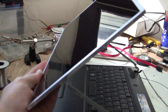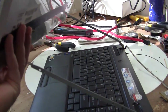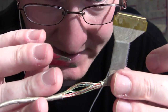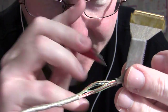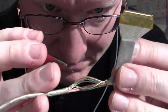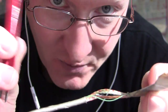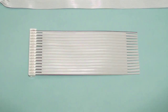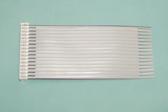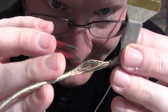So now we can see how far to extend the cable. I've carefully sliced apart the data cable going into the top of the LCD on the laptop. It might look like a big mess, but it's actually not too bad. In the olden days, computers would have flat flex ribbon cable curling up around the hinges and going up to the LCD — you really couldn't do anything with it. But this we could actually hack up and extend.